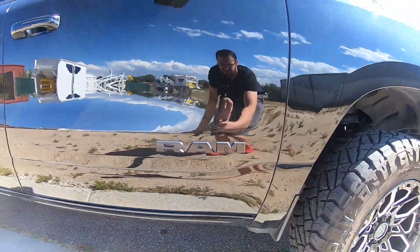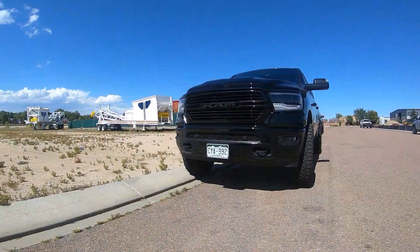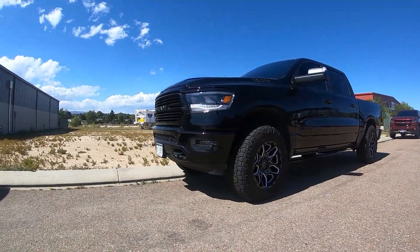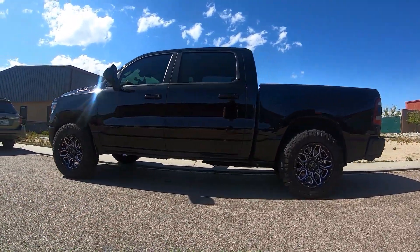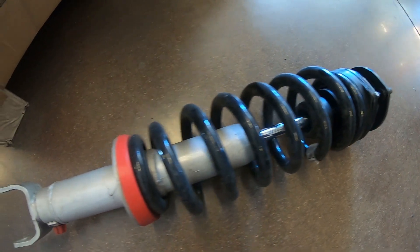What we've got behind me is a 2019 Ram 1500. As we always say, these are very aftermarket friendly — you can level a truck and easily fit 33s underneath with no trimming at all. This one came in already leveled, and as we've alluded to in past videos, there are multiple ways to lift or level a truck: you can go with pucks or you can go with leveling struts. This one came in with upgraded struts and a leveling block on top of the strut.